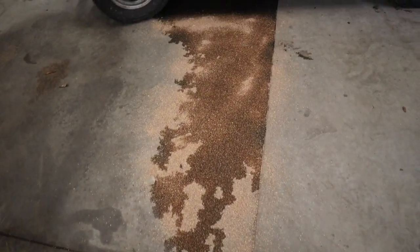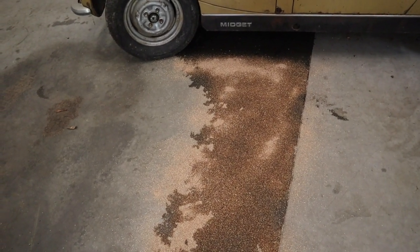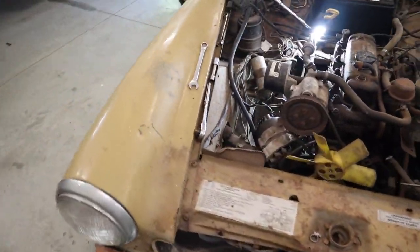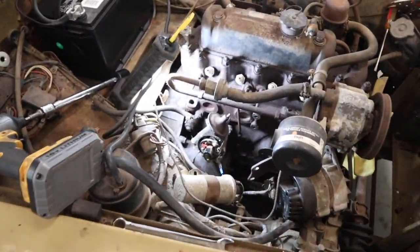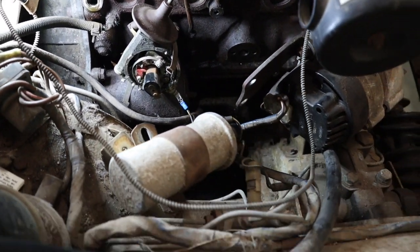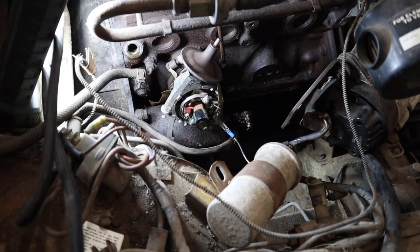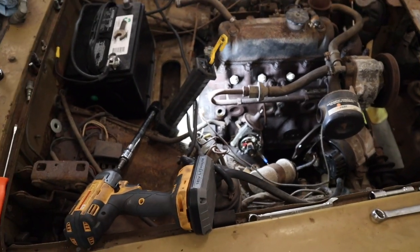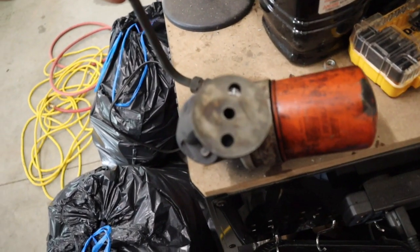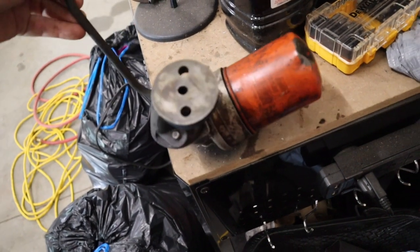As you can see the oil slick has been tamed slightly, though it has also spread — I'm pretty sure there's no oil left in this thing at all. We got that oil filter assembly out of there and I've got it all cleaned up. I took the alternator loose and moved it out of the way so I could get in there. I think the issue was the bolts weren't really tight because I couldn't get any leverage on them. I'm going to go ahead and Right Stuff it, put it back together, let it set up, and hopefully we have something that doesn't leak oil everywhere.